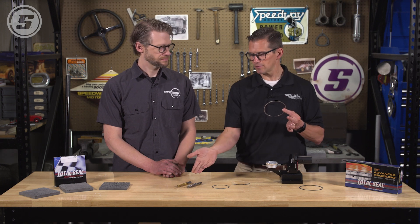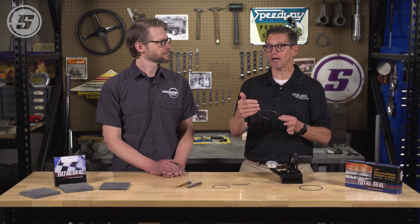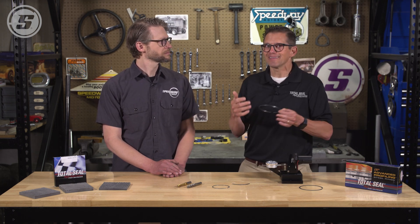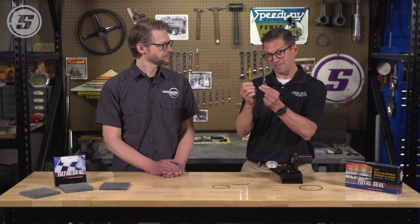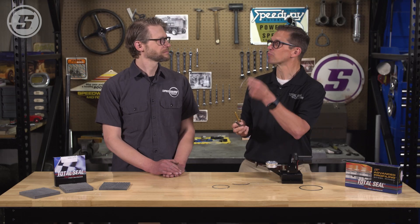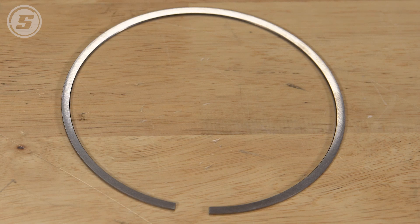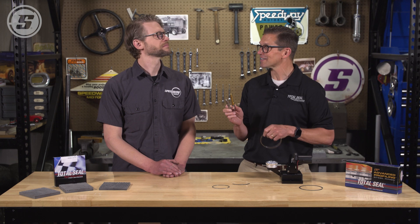So you may be wondering, why is there a gold drill bit and a regular drill bit here? Because when you go to a steel ring, there's two options. You have a gas nitrided steel ring, so there's no coating on it — it's just hardened. It doesn't even flake off that way, which is nice. The downside is that hardened grain is kind of like that regular drill bit. Anyone that's done drill bit work with these two knows a titanium nitrided coated drill bit lasts longer, because that TiN coating is what makes it yellow. This is why it lives longer — that coating provides lubricity, extra hardness, and protection. So a PVD coated steel ring will live longer than a gas nitrided ring. That's one of our little tricks: all the Total Seal AP steel rings are coated rings, so you have that advantage.